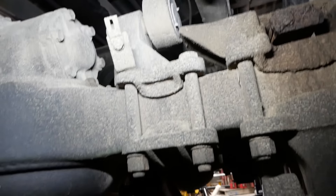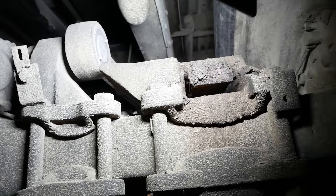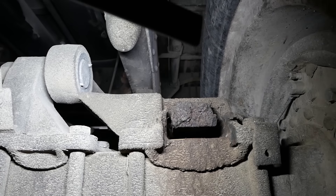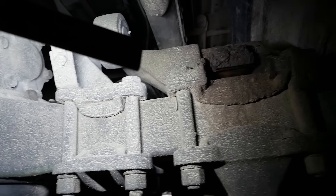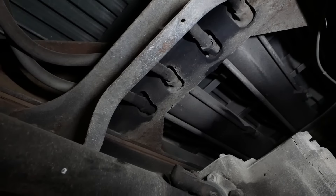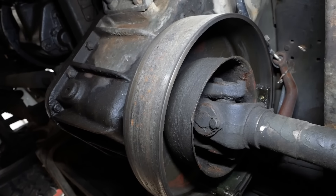There's a single bar at the top and then one on each side at the bottom — kind of a classic suspension setup. There's also some wear pads on the inside surface of these spring pads but as far as I can tell it's not replaceable and you can't adjust the location of these spring pads. They're bolted to the axles but there's a big boss on the top that they fit over so they're fixed side to side. So you're really just stuck with what you got. Pretty cool setup under here — there's the cylinders that dump the box. I'm not sure if it's a scissor hoist. That looks like the valve that controls it. And this big guy here is the transfer case. There's a big drum on the back for the parking brake. There's the transmission.